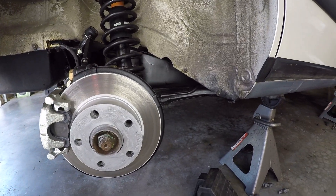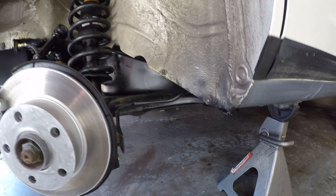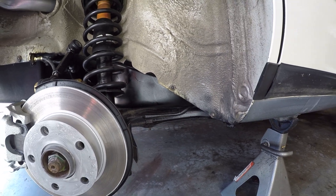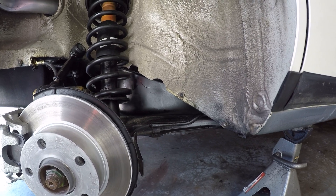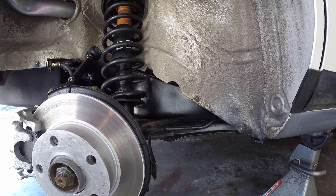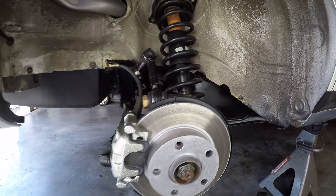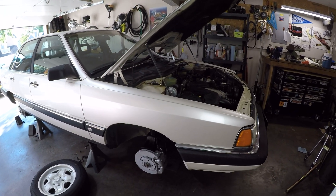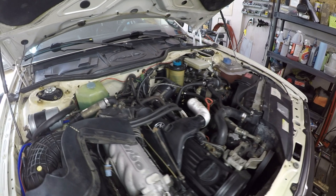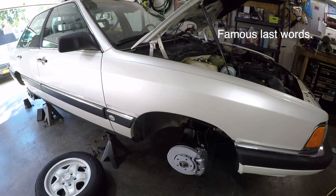The fuel tank — I think it was in the second video I made — I put a patch on the bottom of the fuel tank and the original patch just didn't hold up. I tried it three times and it kept leaking after a couple of days. So I've done a more permanent patch where I took a 16-gauge sheet of steel and used the two-part JB Weld epoxy, the full-strength stuff, cleaned it up real well, and sandwiched that JB Weld with that plate and held it in place with a jack for about 35 hours. It's now been about two months with no leaks. So that is looking pretty complete — this was a ton of work. I spent a good four days getting everything ready and reassembling this car, but I think it's worth it in the end. Now all I need to do is throw the wheels back on and get it back on the ground.